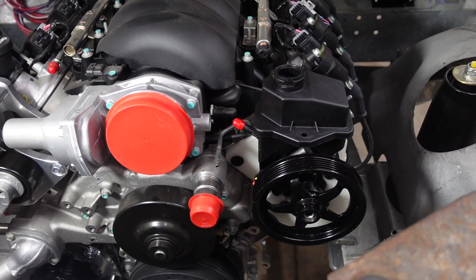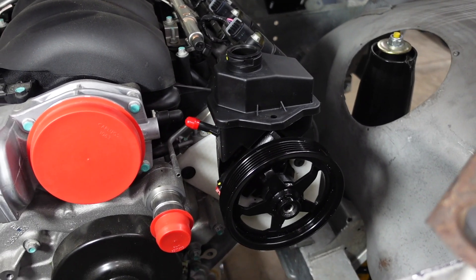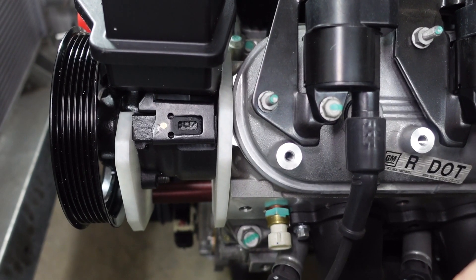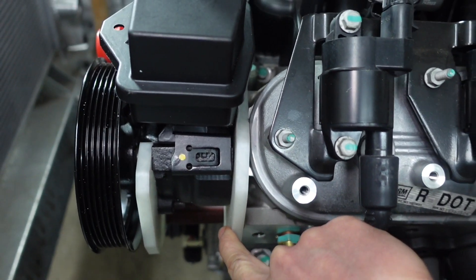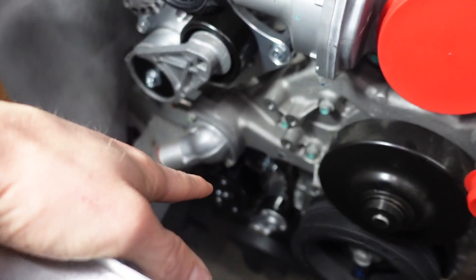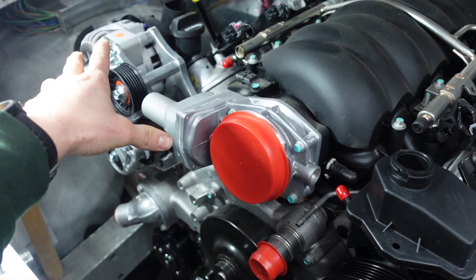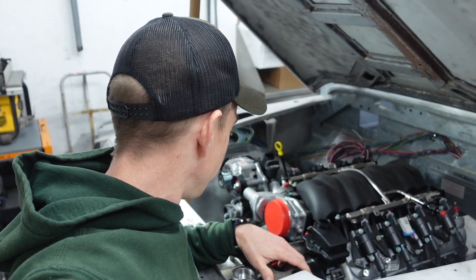That turned out pretty freaking amazing if you ask me. I love where that pump sits — we aren't hanging 15 feet above the intake manifold, and this Impala pump is much more aesthetically pleasing than the old Saginaw truck pumps. We're pretty well lined up belt-wise; we just need to suck the pulley in a touch more with the installer — not a big deal. After we get these made in aluminum, since we're deleting that top bolt, I'm going to make a tab and weld in another one so we have three points of contact on the head. So we're in good shape — AC compressor, alternator, power steering pump, and miles of room to get that steering gear and shaft in there.